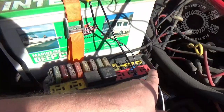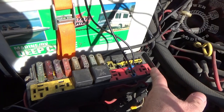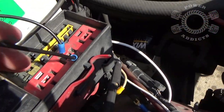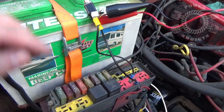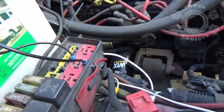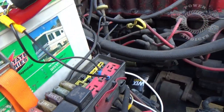Now, over here is your battery and your fuse block — your power distribution center right here. Second one over is going to be your fuel pump. What you want to do is set your wires up. For the electrical side of things, take your cap off here and look right here. You've got one port here, and here's where your next relay is going to be — that is where your fuel pump relay is. I've already got it pulled out right now. Let me explain how this works.